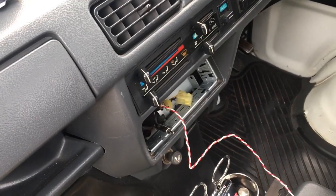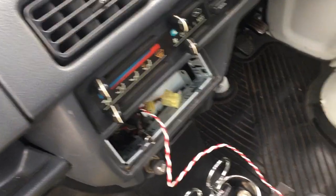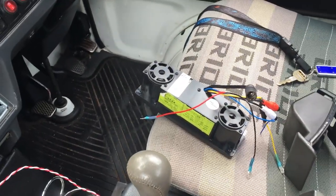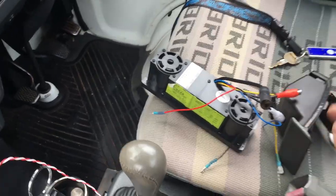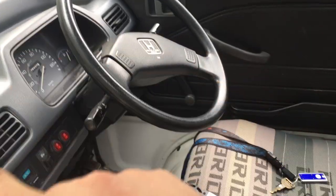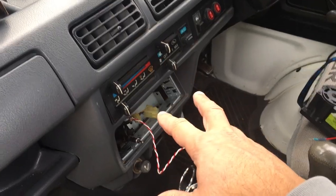But I'm gonna get a replacement stereo, something that's also compact and small like this, that will have a pigtail in the back, with multiple wires for the different speaker connections, instead of these, which I call RCA connectors, because I think that's where you first saw them. But since I have the door card off, I'm going to remove that one too. I'm going to run new speaker wire to the center console, so that when the new radio comes in, I could connect the sound in stereo.